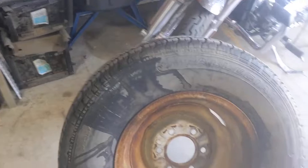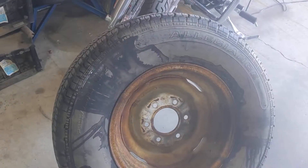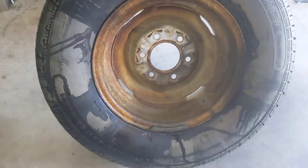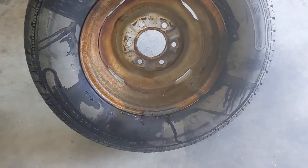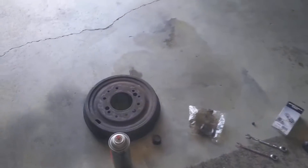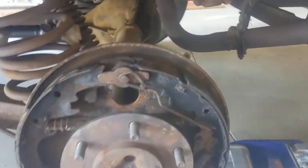This is how you can usually tell — the inner side of the wheel will leak fluid. You can see it's getting pretty bad. There could also be an axle seal going out, but it was pretty obvious when I took the brake drum cover off that it was coming from up high.